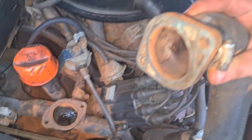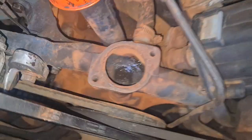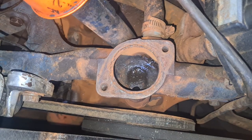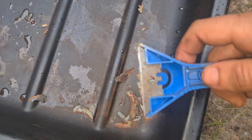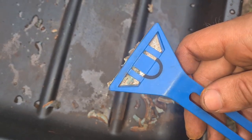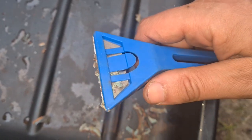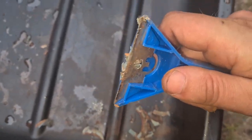I've gotten rid of the old gasket. Cleaned it off as best I could. The surface I previously scrubbed with some Scotch-Brite should be pretty good. The old gasket here was really crusty, so it came off in pieces. But the scraper tool from Biltema ate the gasket pretty well — it went in between the blade and the holder and came out the other end. This worked really well. Cheap tool but saved me a lot of time.